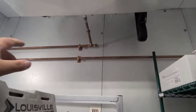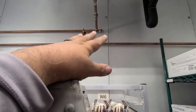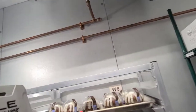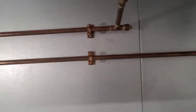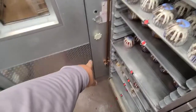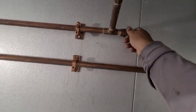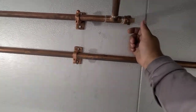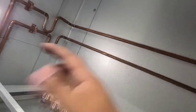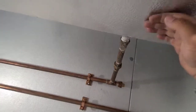Here's the walk-in cooler. Because the cooler does not stay below 32 degrees — it's usually set between 34 and 40, right now at 35 — it's not below freezing, so you don't have to run a heat tape and insulate the drain line. This is the one coming from the freezer — you can see they stopped insulating in here because it's not required. And then you have your trap and then it goes down and drains to a floor drain outside. The freezer has one too, it's just insulated. There's a service port so you can take this off — if it's really clogged you grab a water hose and spray the nozzle through there and flush all the dirt through the trap and out the drain line. You have a union here you can take apart if it's clogged up in the pan or however you want to do it.